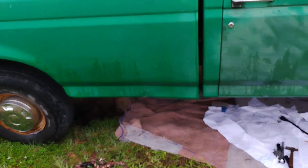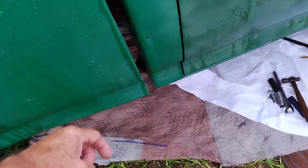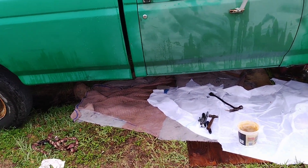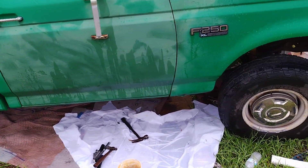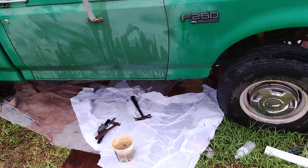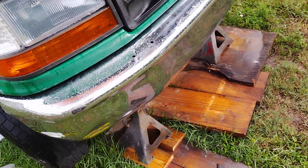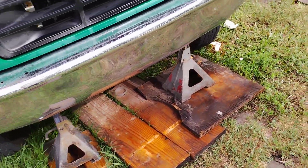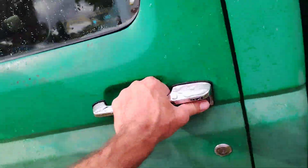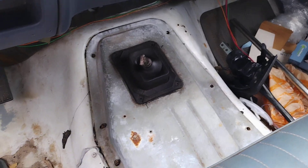Because I want to get her done. I can get my truck down. My blanket's all wet now — I'm gonna have to hang that up. Oh well. I got one carrier bearing bolt to put in. I want to snug up the rest of the — or check all the U-joint bolts on the things on there. And I got to put the stick shifter on, and the boot and all that. I got to screw the plate down, put the shifter lever on.